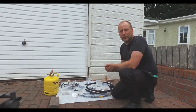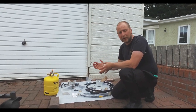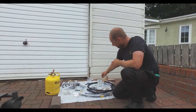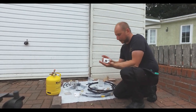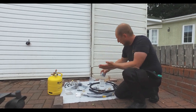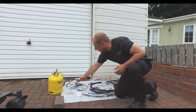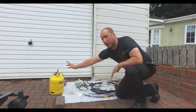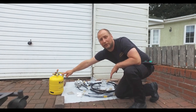So how are we going to do this conversion? I've got a number of parts that we ordered from Century Fuel Products in the USA. We've got a carburetor — it's a block type carburetor. We've got a regulator and a safety valve. We've got a series of hoses and a 2.7 kilo LPG cylinder.